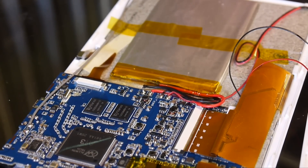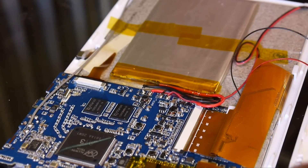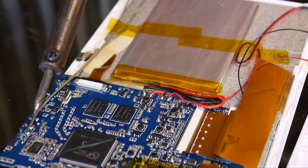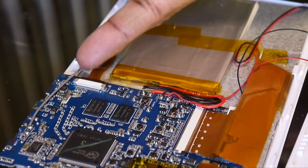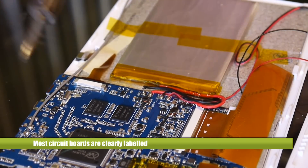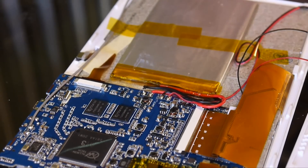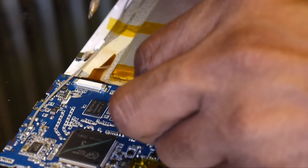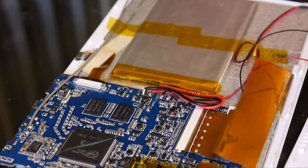I'll leave it for about a minute or so and then I'll reconnect it. While we're here, if you had a problem with your Wi-Fi connection, you could just pop some solder on here — down where this gray wire is, or it could be any uncommon color wire. Just solder it up if it's got any dry joints. Right, that's about a minute now — simply just reconnect it back onto the circuit board. Like that, that's all it is.